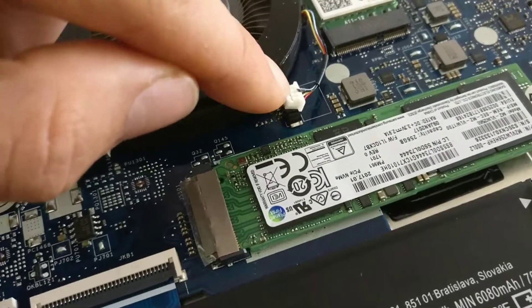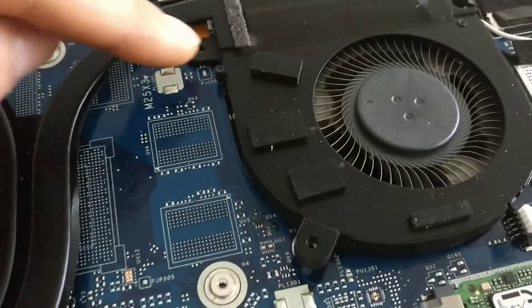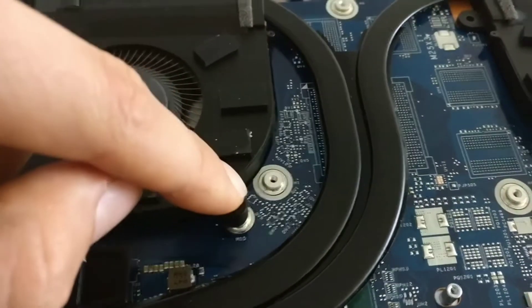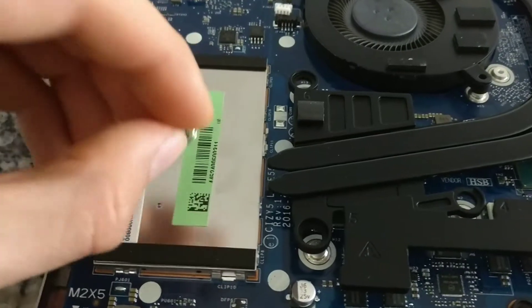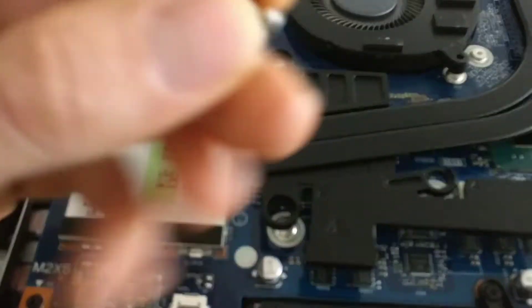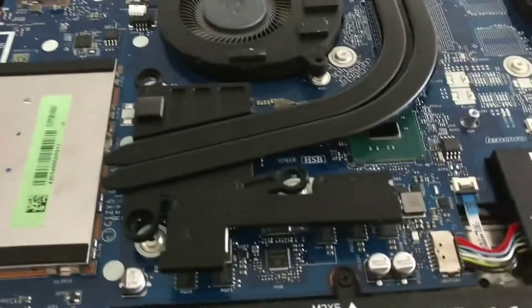The cord goes here on this side, and then for this fan there are three screws that go in here, here, and right there. On this side there are two that go there and there. Once you have those unscrewed, you can unscrew the three screws that hold in the heatsink, which have this little spring on them so that you don't have to tighten it too hard — just hard enough that it really pushes the heatsink down on the processor.